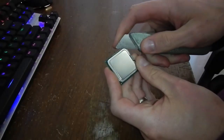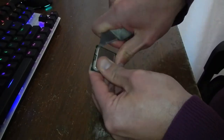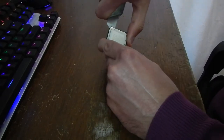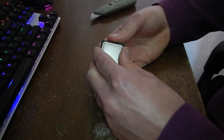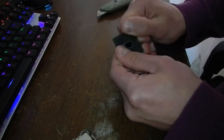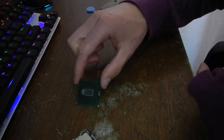I like my motherboards medium to well done — this one definitely is. So this is something I have done before with varying results: removing the heat spreader off a Socket 775 CPU with a Stanley knife. Be careful, don't cut yourself — it's going to make one hell of a mess, ask me how I know. Back in the day these were just silicone they used to put on there; these days they solder it on so it's much harder. Just going to remove that — you can use a pick. There we go: nice clean die on the CPU with the heat spreader off. Thanks for watching this video, it's been a disaster as always.